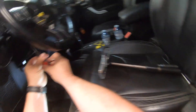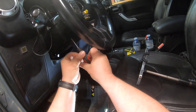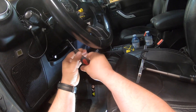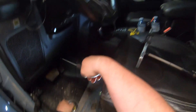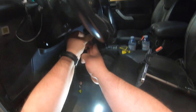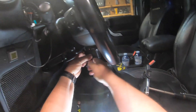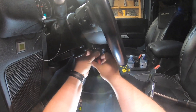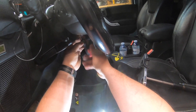The easy Torx is out first. Now I've got the screwdriver up inside there removing the Torx from the console. What those long bolts do is they go through the clock spring and then tighten up to the cover on the very top, so you have to make sure those are all out. There are only three bolts in total — remove them and you're good to go. This is actually a very easy, simple project and it should take you about ten minutes.